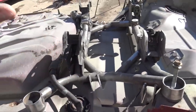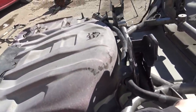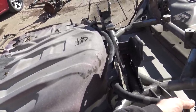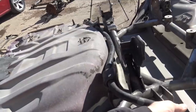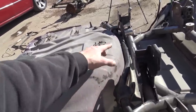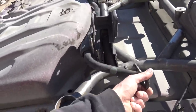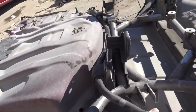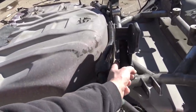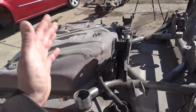So now I'm very happy that the sway bar, if I lift it up here, it's gonna have plenty of clearance. So I could push this out about a quarter inch would be perfect. But before it was like that far out and it was just touching, interfering with this spare tire wheel well. Wasn't gonna work. So even though I can push it out that far, I think I'm probably gonna just have it flush with this piece of metal here and then make a bracket come out here on the bottom, just so I'm not having to worry about any interference issues.